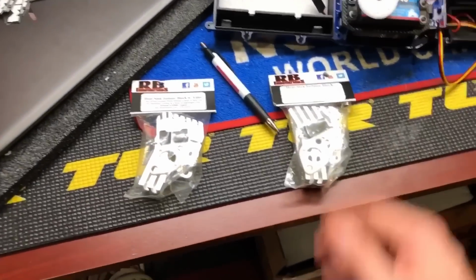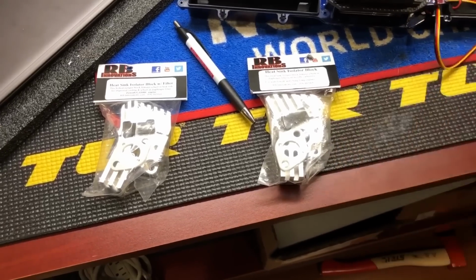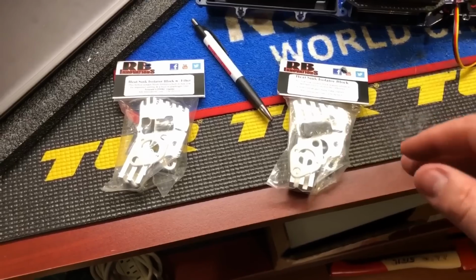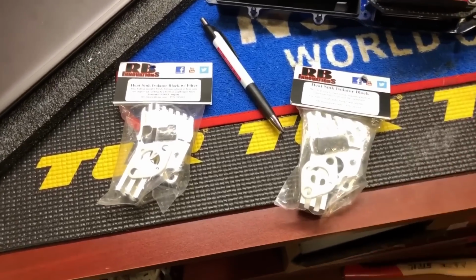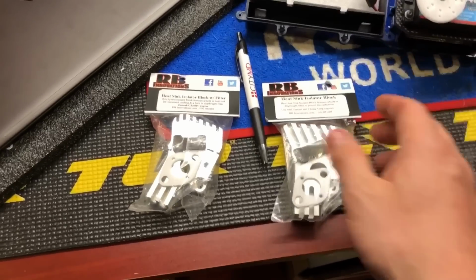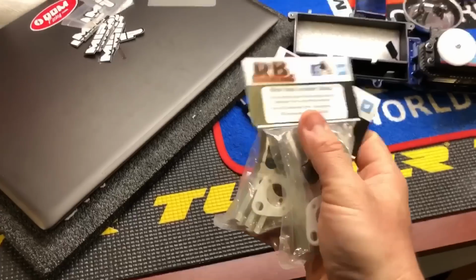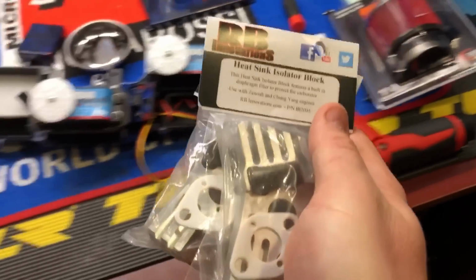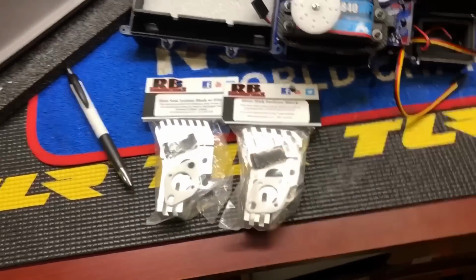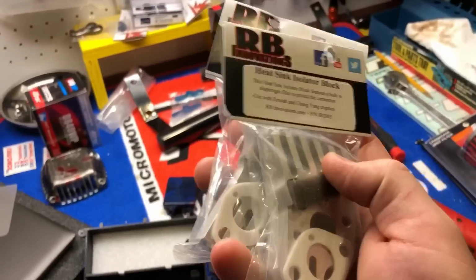I love smaller engines, and you can build them, stroke them, port them out, do big bore kits, and you can actually get smaller engines to outperform bigger engines. So don't be knocking small engines, as long as they're 4 bolts. 4 bolts is very important. There are some 2 bolts out there that can kick butt, but there you have a higher risk of head gasket leaks and issues, and there's no need for that. Since a couple of my subscribers scared me, I wound up getting more of these.